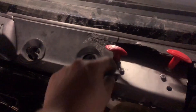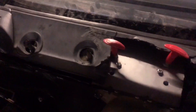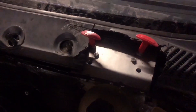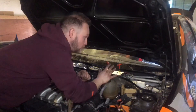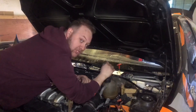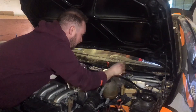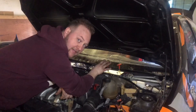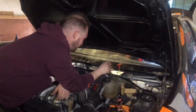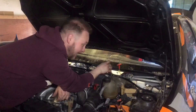I'll get a new scuttle panel and then I won't have to cut all of this section out — I can keep this here and literally just cut a square out of the centre. So what I'm going to do now is feed the new pull cords through and attach them properly, and then hopefully jobs are good. The new pull cord mount is now installed and the pull cords are attached. What an absolute nightmare that was. I've greased them completely from top to bottom, pulled them out, greased them down, put them back in. I think the main issue I had with the original pull cords was how they were running — they were just getting crushed. Whereas now they have a nice, relatively free run into the car, so hopefully once I attach everything they both work.